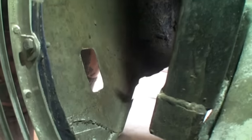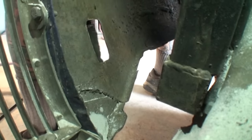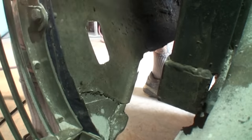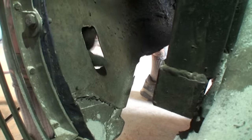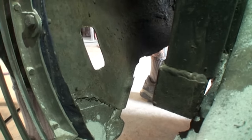There's no way. You can see where they added metal. Do you see what I'm saying? Oh, yeah. See this lip right here that's different than the original lip. And then you can see where they welded it on right here. Yeah. And that's telling me that's why the brackets are not the right brackets. It looks like the bumper went down in here somewhere. And we don't know what's been done to these or how modified these things are.